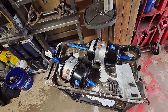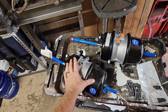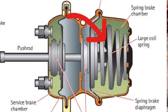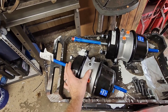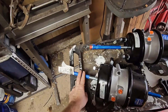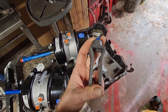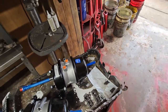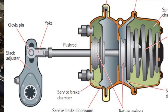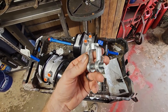For all the people that don't know what all this stuff is, these are your brake chambers. You can call these spring chambers because they have a built-in spring that acts as a parking brake or emergency brake whenever you have an air loss. Then they have just your regular brake right here that applies pressure whenever you push down on the brake pedal. This is your push rod, which attaches to the clevis, and the clevis attaches to your slack adjuster out here.